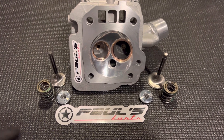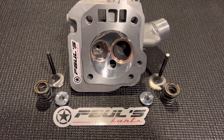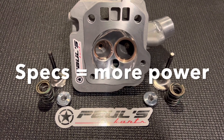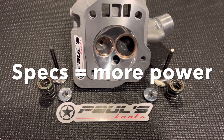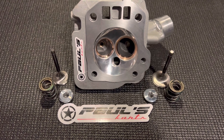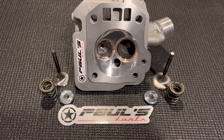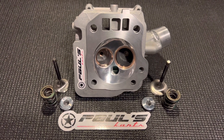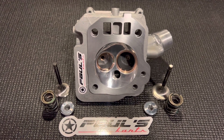When you purchase through the site, you fill out and send us your specs. We have all the specs for the engine — we can size the ports accordingly, size the chamber, get the velocity as high as possible while still allowing enough CFM for the bottom end. We do it at 130% volumetric efficiency to make sure the engine gets everything it needs.